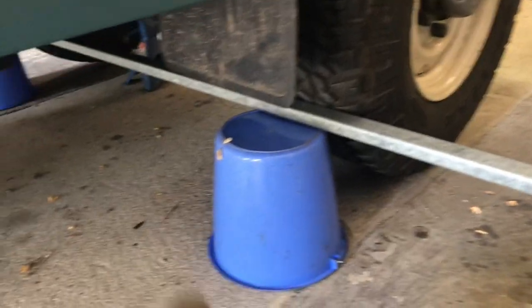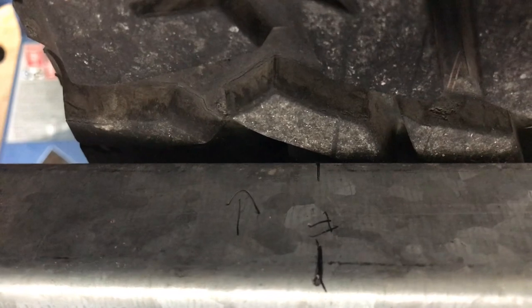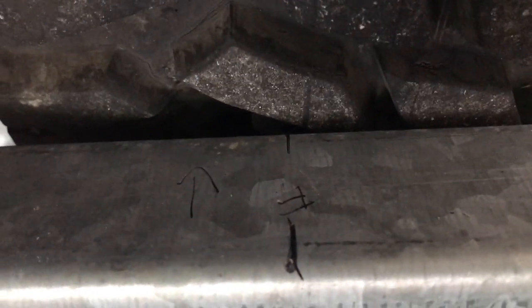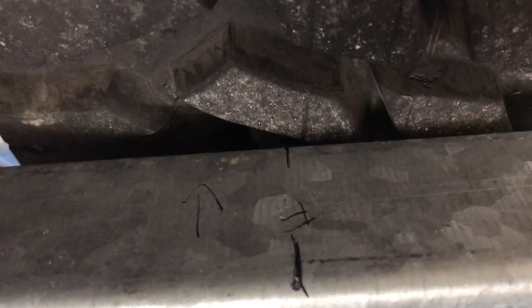Then you move the setup to behind the wheels, and by lining the marks up on the tyre on the other side, you can see the difference between the measurements. This quite clearly shows about three millimetres difference. So I think I might have a toe-in a little bit too far, but not by much. I think that's pretty good.